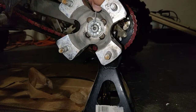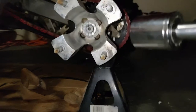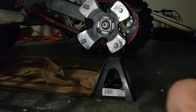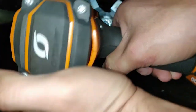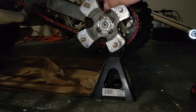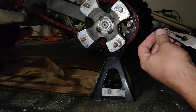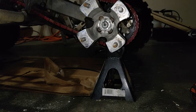There's no wiggle here. The issue I was having before with that extra washer - these newer castle nuts are so much fatter that you can't really put a cotter pin through. In my case I'm using a nail. I'm going to get more cotter pins tomorrow - I found some at Home Depot. Take that washer off, set the castle nut back on, and the nail slides right through. It fell through on its own because it's already bent, and that's that.